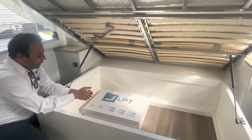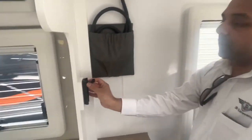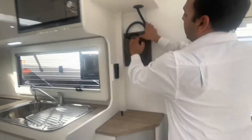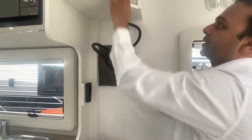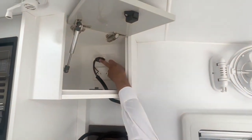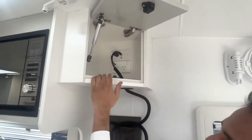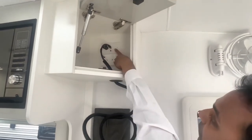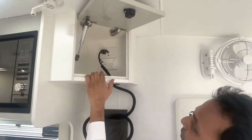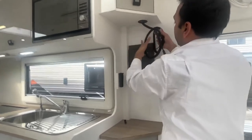There's a 24-inch smart TV — just like any TV at home. It comes built into a bracket and I'll show you the TV setup now. The bracket slides in and the TV sits on it. All the cable connections for the TV are here — you've got the antenna connection to the back of the TV and the power connection coming from the top. There's an on/off button: pushed in is on, pushed out is off. Make sure you keep it in the off position, plug everything in, and then switch it on — that way the chances of blowing a fuse are very slim. There's also a little automatic booster switch — make sure that red button light is on full-time to boost the signal as needed. There are also double 240V power points for a DVD player or other devices. Once done, wrap it back to position.